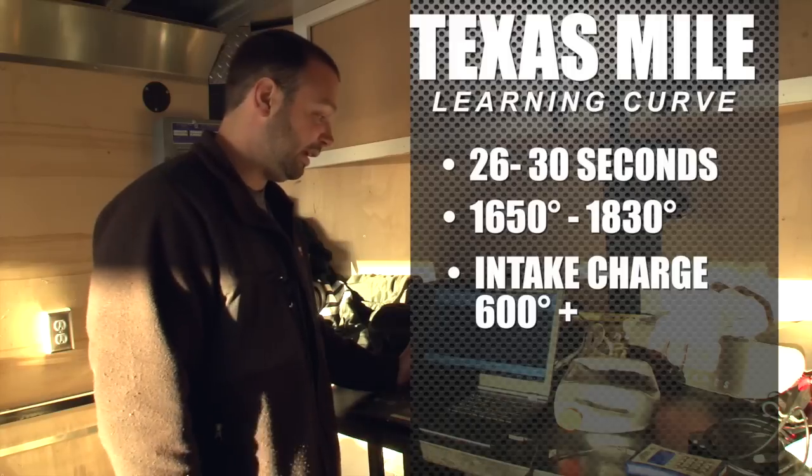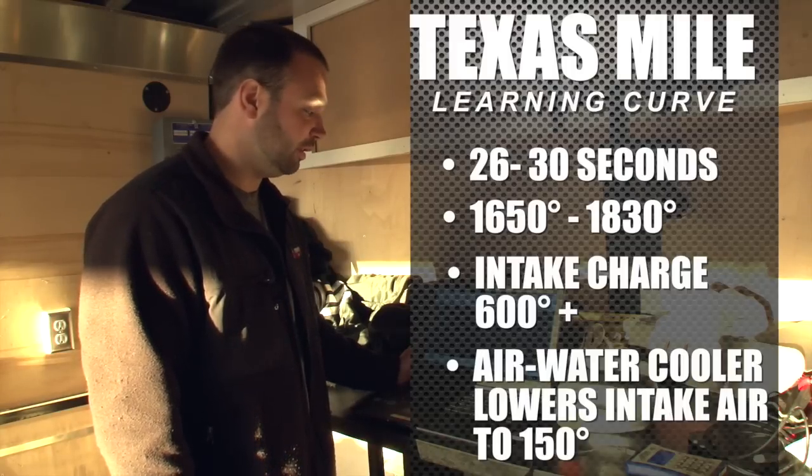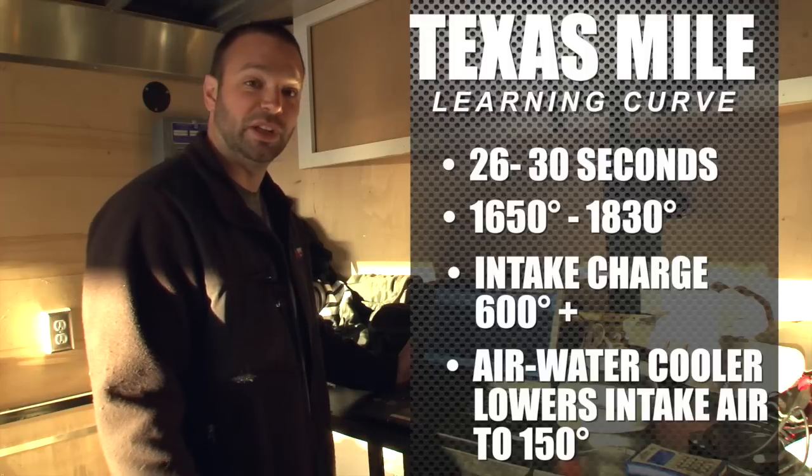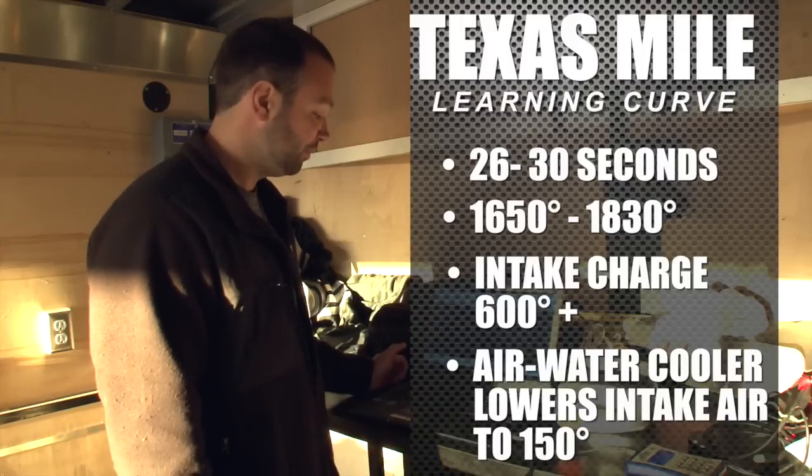And what we're seeing is that the air-to-water intercooler system is peeling just a ton of heat off that intake charge, 450 degrees, and allows us to keep the front of the grill taped up and keep all the air out of the front of the motor.